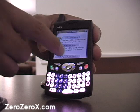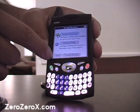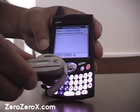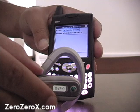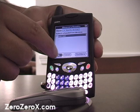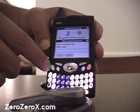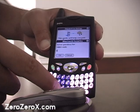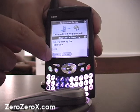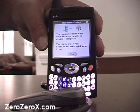We need to put the Bluetooth headset into pairing mode so it can be added to the list. We go to Hands-Free Settings, press Next, and then press both of the rocker keys on the headset itself so it enters pairing mode. It shows up in the list, we press on it, press OK — it's been discovered and it's connecting. Now we input the passkey, which by default is 0000.